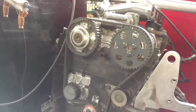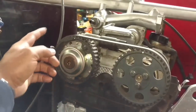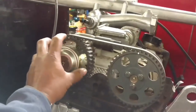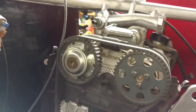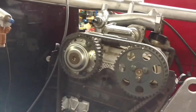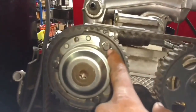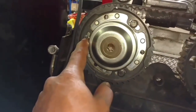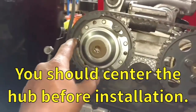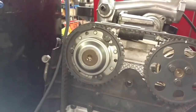One point you should know: on the earlier ones, this hub is spring loaded. So you rotate it around clockwise, snug the center bolt, then when you let it go, it will probably spring load counterclockwise about two teeth — that's how it should happen. On the newer models, these hubs are not spring loaded; they just have play in them. So after you have the hub set, you can loosen the smaller bolts out here — they may be 8mm. Once that's set, you want to try to center these as best you can so that you have play on both sides of those bolts. Snug those down — that is where you want your initial setting to be.